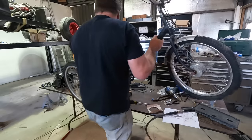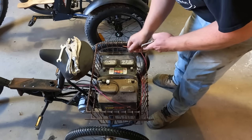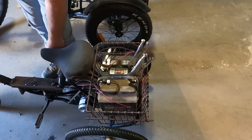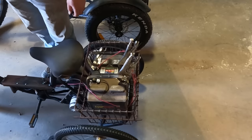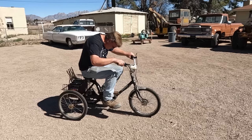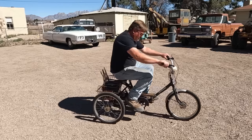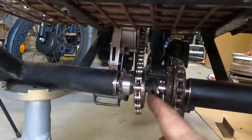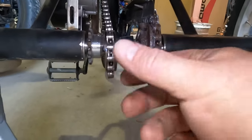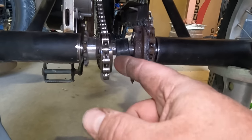Batteries fit perfect in the basket. Time to get the batteries hooked up. Turn the key, hit the gas — it moves. We take it for a spin without pedaling first. Just broke my welds — my sprocket adapter broke almost immediately. I had it set so the threads would tighten as you apply power, but apparently the force of it turning pulled it sideways and ripped it off, causing it to disengage. I've got to make that better.